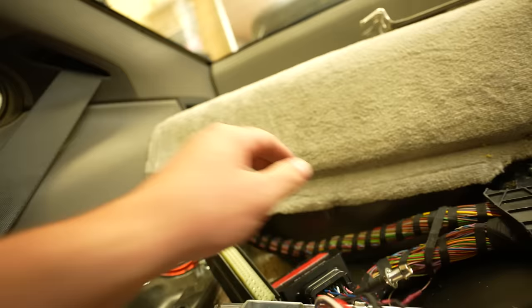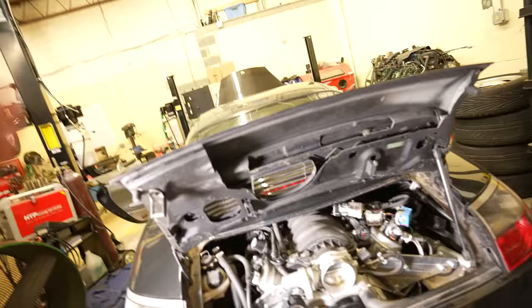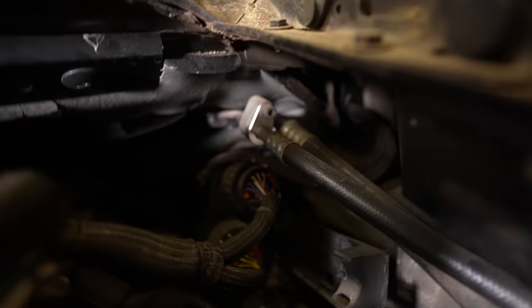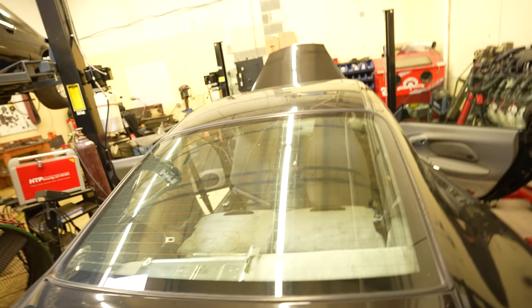This is their CAN box - I think this is just for the air conditioning on this car, though they have a little more functionality in some of the newer cars. Over here that's just all the factory Porsche stuff, minus one AC wire. All in all, not a lot of ugly surprises under here, so I'm super grateful for that. I was wondering how the wiring was actually making it inside the car to the ECU, but it's actually using these body connectors to run in where the factory ECU was. That's why all the wiring is so clean.